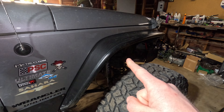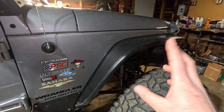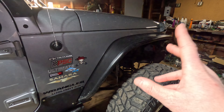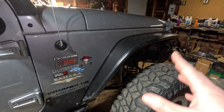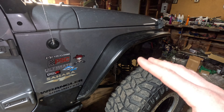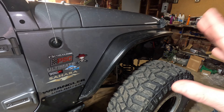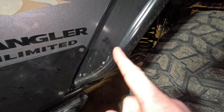No matter which one you order — steel or aluminum — I would definitely recommend you go with the armor coat. For the front fenders, I just rattle-canned them. I prepped them for a long time because aluminum is harder to get paint to stick to. I did about four or five layers of spray paint over a couple of days, followed the instructions carefully. And I already have chips — I already have chipping in the paint on both sides. The aluminum just does not hold paint as well as steel does, and that's something I've read across a lot of forums. If you get it powder coated it's different, but I was not going to pay someone to powder coat these.